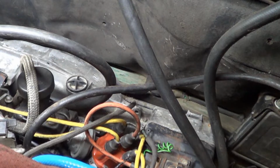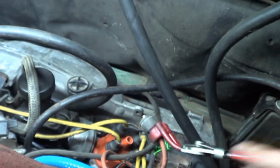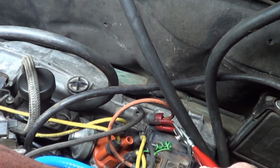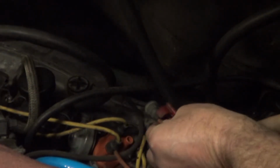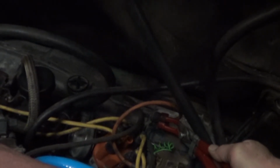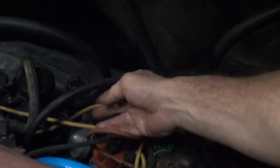So now obviously this is a 47-year-old car and it's entirely possible it might have another problem besides receiving bad fuel pumps. I've already done this, but I thought I'd show you for the camera that I have checked that it is getting spark. I don't know how good this is going to show up. Maybe I'll turn this light off and you can see it. Pretty sure you could see that it's getting spark, and I did try that at the number one spark plug, the spark plug here also, just to make sure.